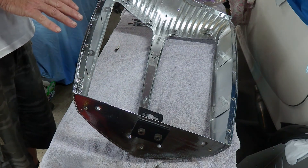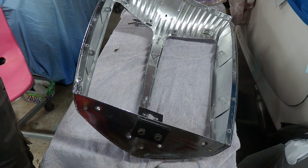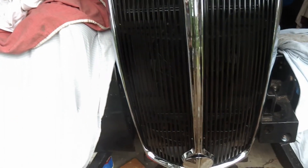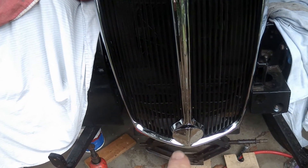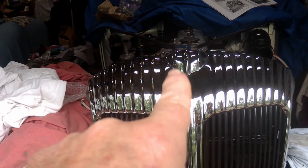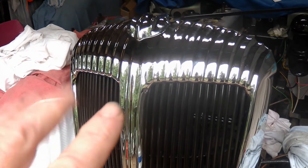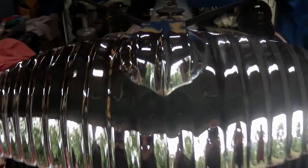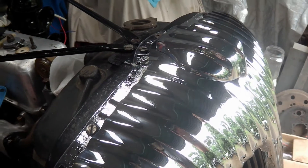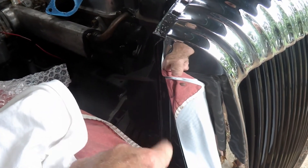So anyway, I'll start to reassemble it - it shouldn't take that long. Nice to keep saying that just to encourage myself, hopefully it should be straightforward. I've got the radiator components back in place. The centre of the grille is all bolted in. The cap over the crank handle is done, and I'll put the chrome piece on the top there, so that's all complete. The radiator surround at the moment is only just temporarily screwed into place - there's four screws across the top, a couple in the middle, a couple each side. It's ready to bolt up with the side plates on each side.